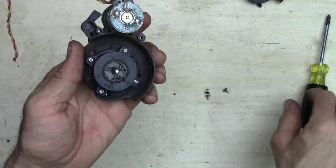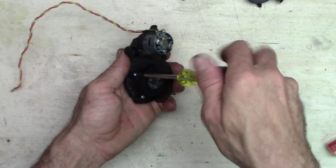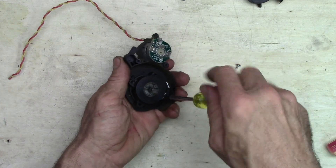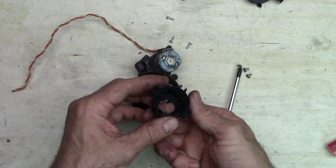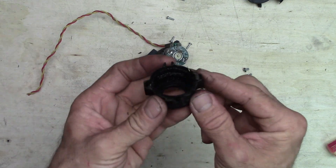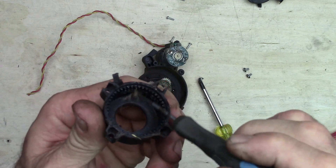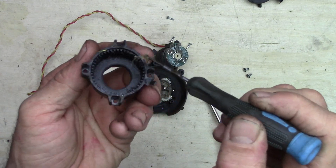Now this part is the planetary gear assembly. We're going to take these four screws off — they hold the housing for that planetary gear. It actually is the planetary gear, I guess. Or is it the sun gear? I always get that confused — you can go look it up. Go Google a planetary gear transmission and you'll see how they work. They're really cool, really compact transmissions — it's what's in a lot of cordless drills these days. Now this one isn't too bad inside, it's fairly clean. This has still got a lot of grease in it. Inside here in these gear teeth I've seen a lot of yuck built up on other ones, but this one's not so bad — it's just still got some of the grease from the factory in it, and only a little bit of hair.